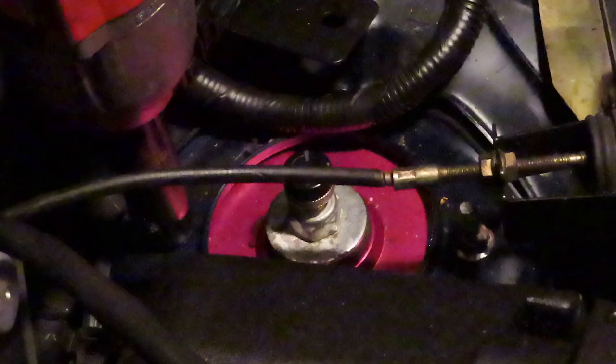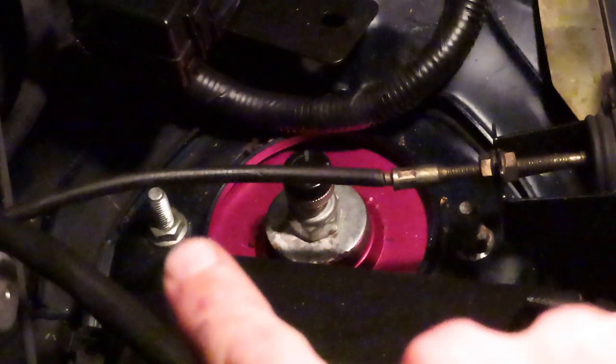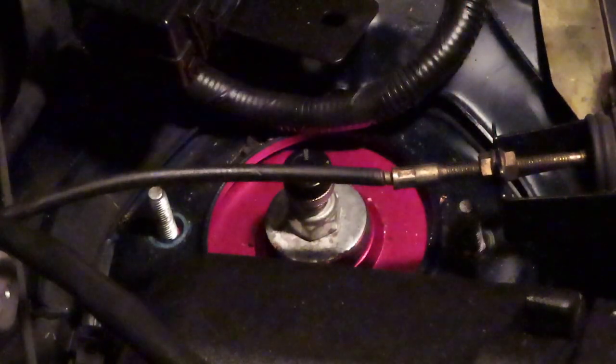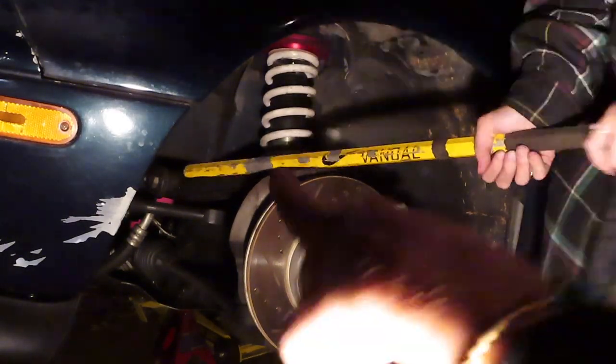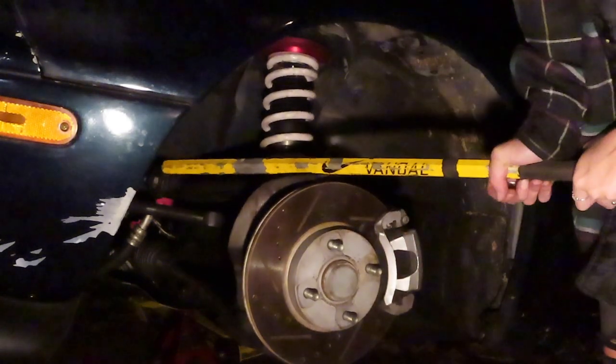Got the bolt from the other side — this will be loose. Let's go up top and loosen the top two bolts. Next, we're taking off the top hat bolts. There's a nut right there and a nut right there — that side's a 13mm for some reason, and that side's a 12mm. So what you're going to do is put any bar — I'm using a lacrosse stick — between the frame right there, over the top of this arm, and you're going to press down and then pull the coil out.